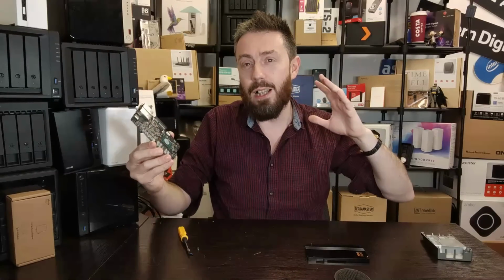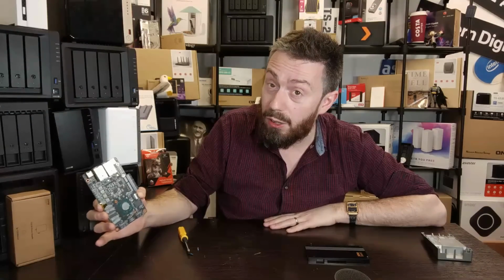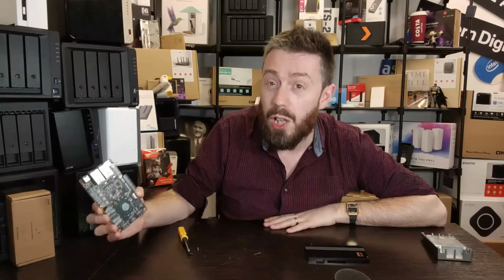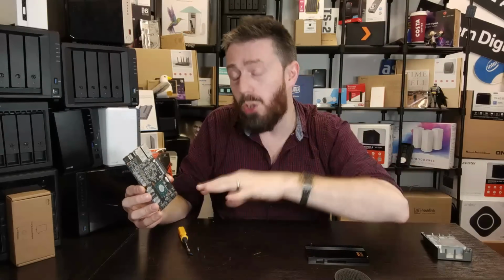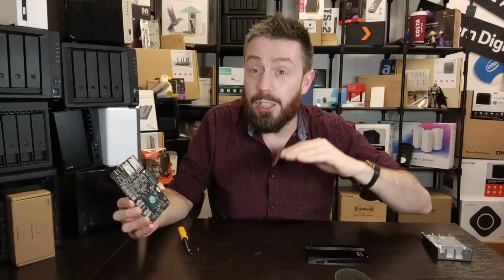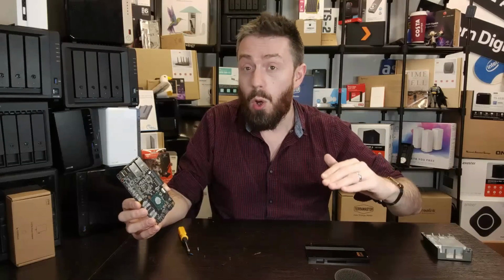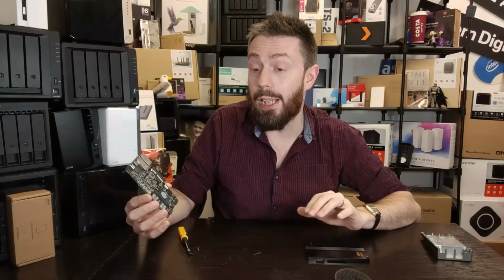But if you're looking at things like TrueNAS, this is not going to cut the mustard, because notwithstanding that the CPU is fairly modest to start with, that 2 to 8 gig will hamper you somewhat, with TrueNAS being a little bit greedy on the old memory to start with, and certain highfalutin TrueNAS services, even if the CPU could run them comfortably. On 8 gig of memory, things like inline data deduplication and inline data compression, or compaction, are not going to run that well on 8 gig, or at all in some cases.